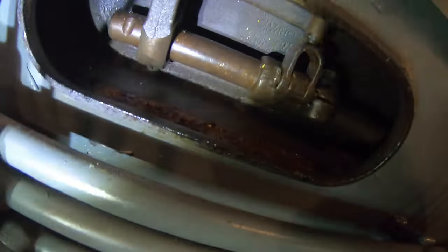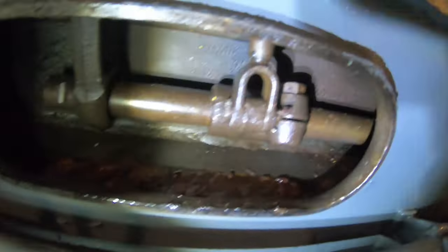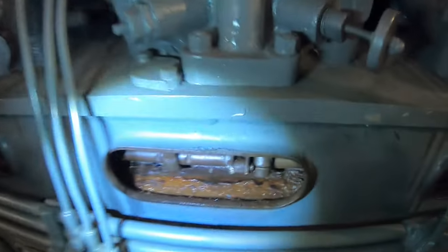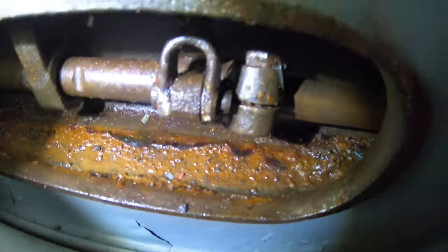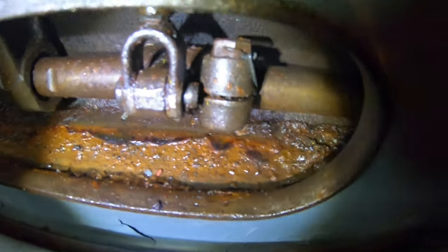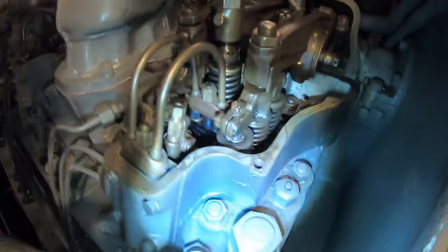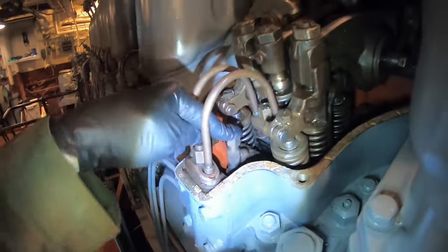So you just saw me take these covers off, and this is what it looks like. Essentially, what you need to know is that there is this shaft here. You can see it's got that pin there, and then that travels up through here, and that's how it moves the injector arm. So if you have an awful lot of resistance in that lever, basically what you have to do is rotate that, remove the pin — the safety pin there — and then pop that. That will take this injector off of this shaft here, and if it suddenly gets very easy to move the throttle arm up and down, then you know you've got the sticky assembly. That one's moving pretty well, and that one's moving all right.